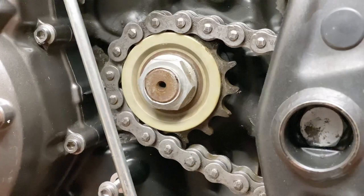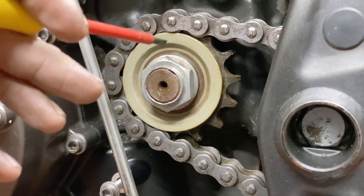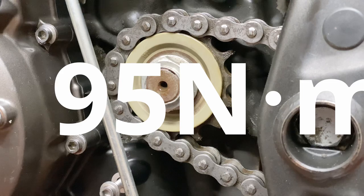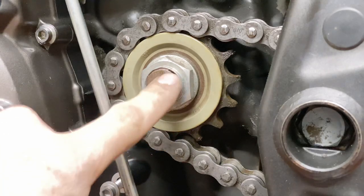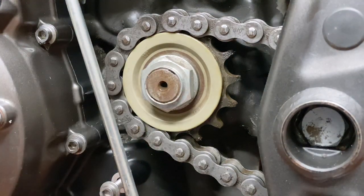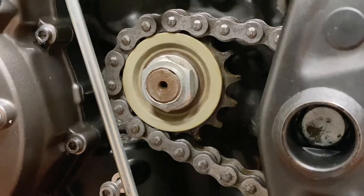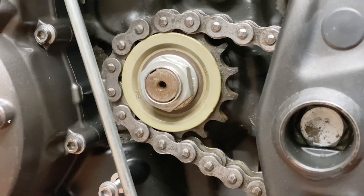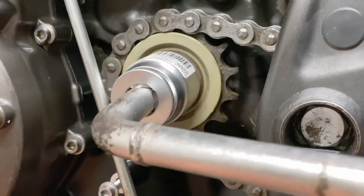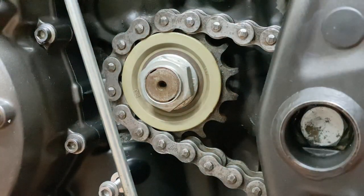I can now move it with the bike in neutral. The nut should have 95 Nm torque, and I have not touched this at all. So I have a big bar here — 95 Nm is 95 Nm — and I have neutral here. Let's see. I really think that this was not tightened up from the factory.